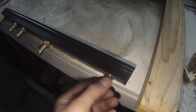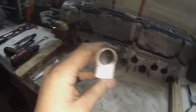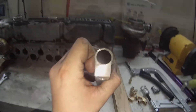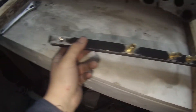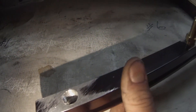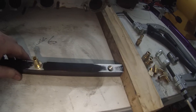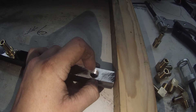I use a Sharpie to mark guidelines for where to drill the hole. This is a rail — I bought it at Summit Racing. It's a blank fuel rail, cost me $29.99 or something like that. I'll put all the part numbers in the description along with a total of how much this exact setup would cost you to do yourself. It's a blank, anodized black fuel rail, 24 inches long total — I cut it down. You can get them in all sorts of different bore sizes, colors, and raw finish. It's a build-it-yourself rail, so you drill out and tap each hole. I drilled and tapped five holes and had the rail sitting where I would want it, then I was able to mark the holes.